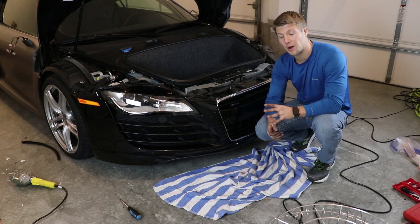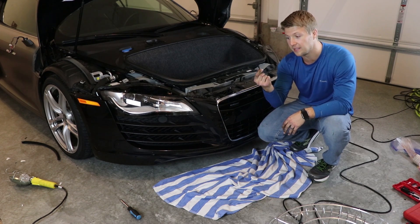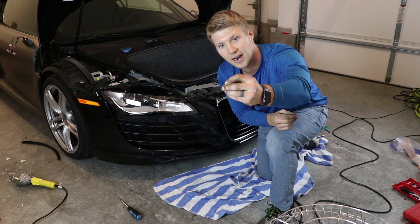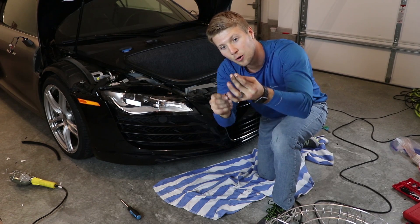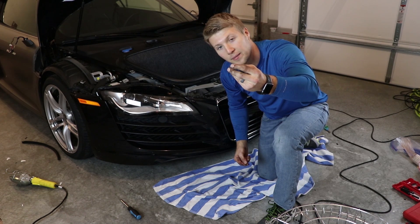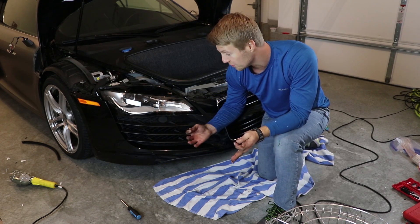We have been struggling for quite a while. Everything felt loose on the edges but underneath something still felt tight, and it's amazing how a small little piece can hold something very tight. This is called a push pin — we knew we were looking for them. I pushed the center out of the push pin, which is essentially a grommet-type plastic that holds it together, and the push pin tightens everything down. You can push the center out with a small bolt, which loosens it, but it would not come out. Eventually we pried and pried and it finally came out, and that's what allowed us to loosen everything up. Hopefully now we can easily pull the front bumper off.